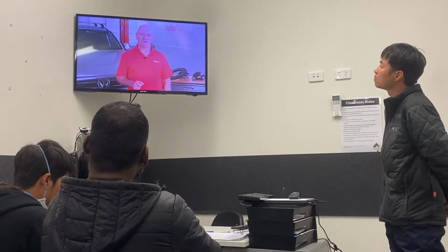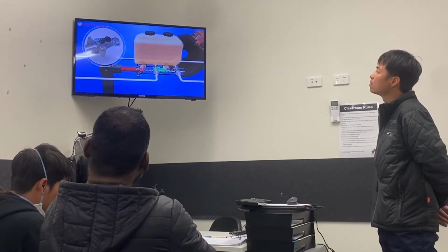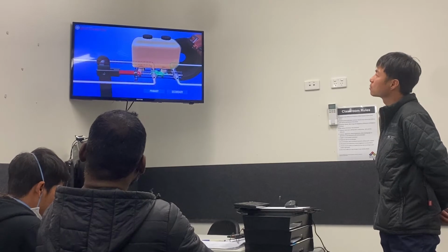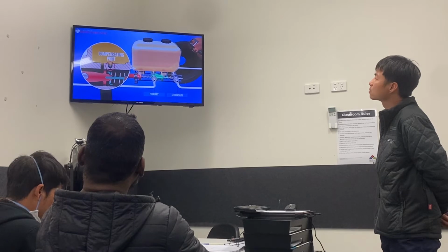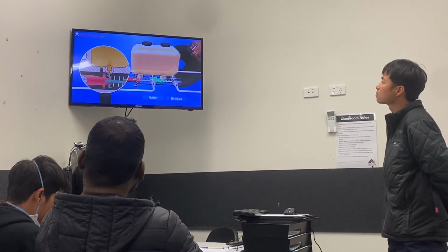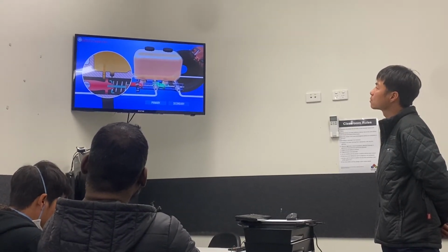Ports are used to allow the flow of brake fluid within the system. They are often named differently but serve the same purpose. There are two outlet ports on a tandem master cylinder, a primary and a secondary. These are connected to each brake circuit via a pipe. There are two internal ports per brake circuit. They are known as compensating or vent ports and inlet or replenishing ports. The compensating ports are in front of the piston seals and allow brake fluid to flow from the reservoir to the brake circuit chamber. The inlet ports are located behind the primary seals and allow fluid to flow to and from the reservoir.